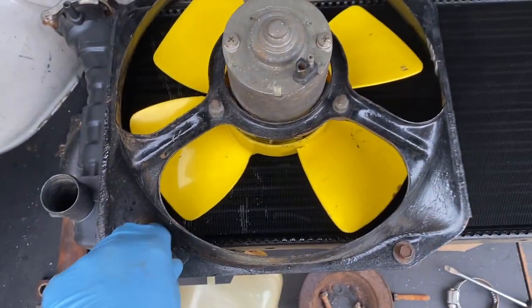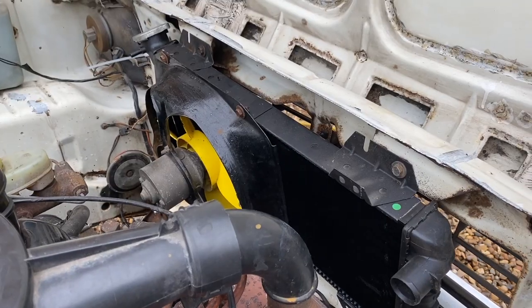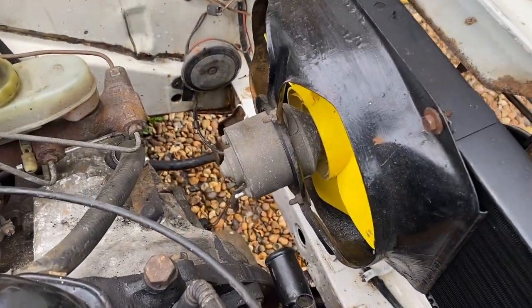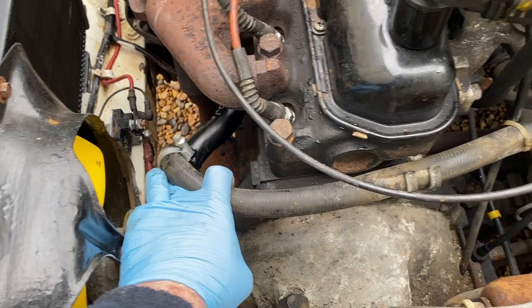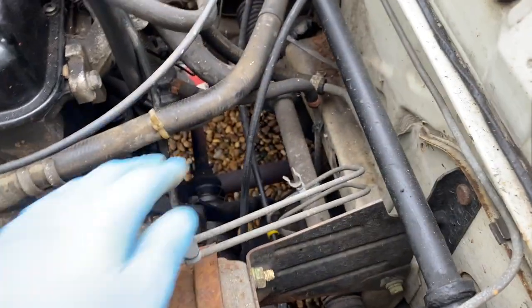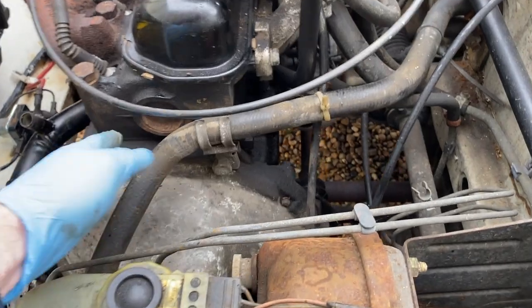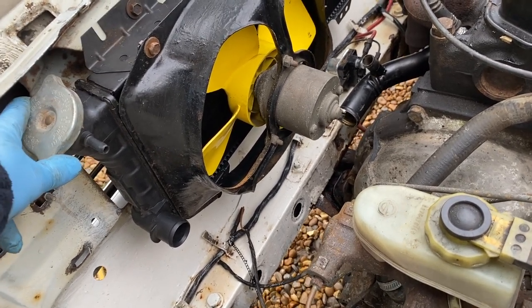Screwing in place the bolts that hold the fan onto the radiator — let's get this radiator into the car. We have a radiator in place! Just need to get the top hose, bottom hose, and expansion tank in place, and the electrical connector onto the fan. I've ordered new heater pipes — the current ones are really hard and crunchy, and one has a split in it, so replacements are on the way. I won't connect that one up for now, but I will connect the bottom hose — and as if by magic of television, I think that's what's happening next.